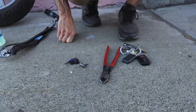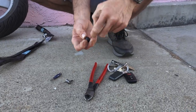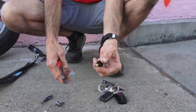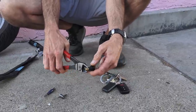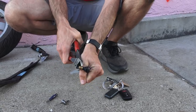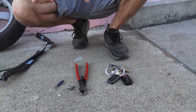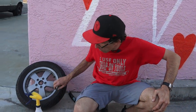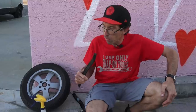Today I'm going to use a little portable air pump and see how that works. If you're going to change the stem, you're not going to be able to get it in and out on your own. Just like with the tools needed to pull the wheel off, you're going to need a diagonal set of pliers. Say you need to change the stem out — you can cut the old stem out with diagonals, and they also work very well as levers to pull the stem into the wheel. The last tool you'll need is some means to demount the tire from the rim. To break the bead, I'm going to use something that weighs a lot and rolls — and that's called a car.